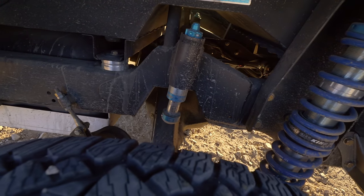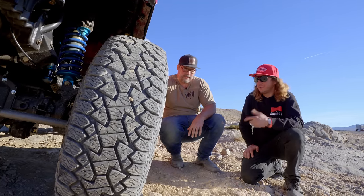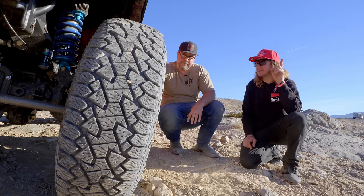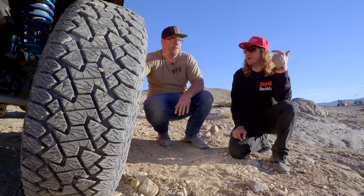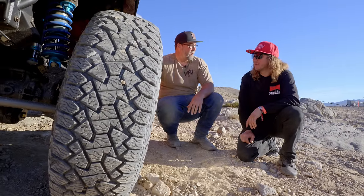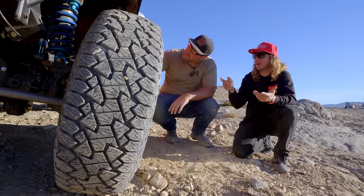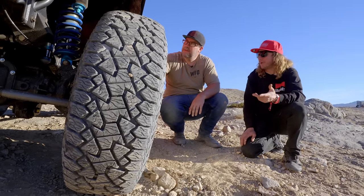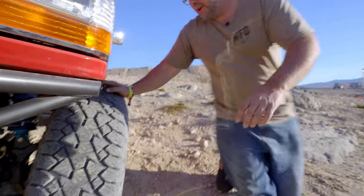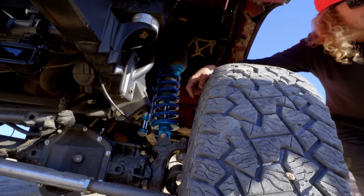King air bumps are limited to about two inches of travel so it's not slamming on the bumps all the time — keeps the center of gravity low, and gives a little extra resistance on up travel when flexing. Limiting that bump travel means you're not always in the bump zone while crawling slowly. The shock mounts were a breeze using Desolate bolt-on shock mounts — locate with three-eighths bolts and weld it on. The front shares the steering box bolts — that's the Desolate shock mount — and their track bar bracket goes right on there too. Also running a 7075 billet tie rod.